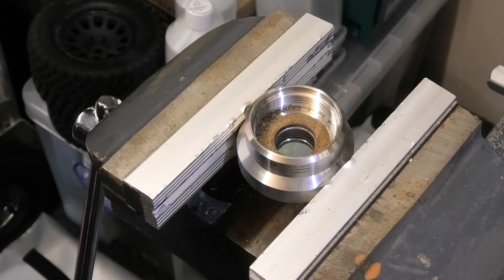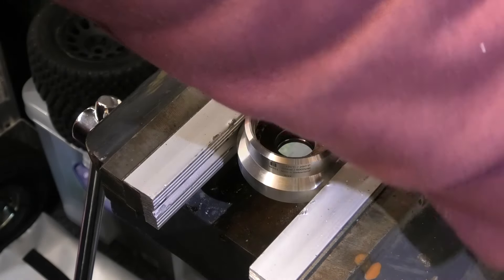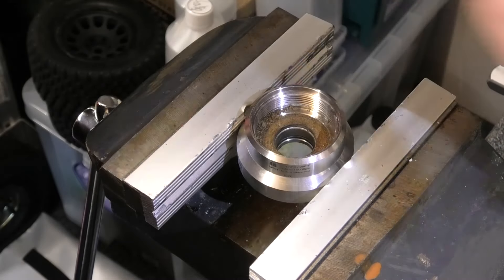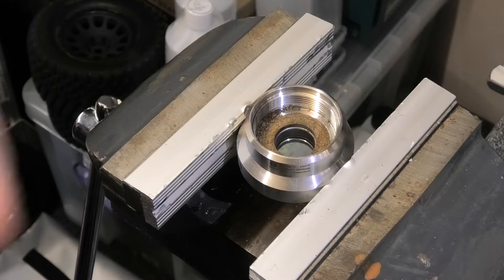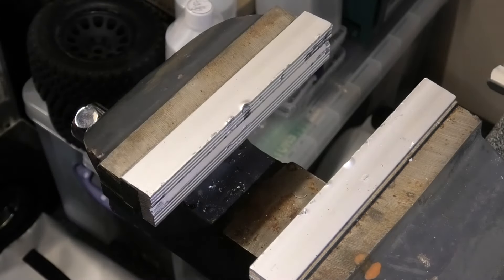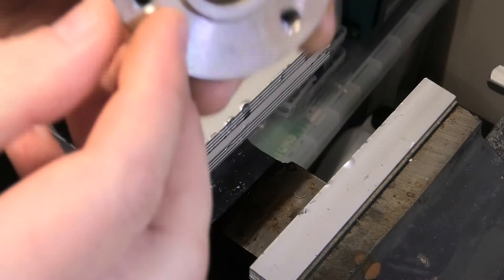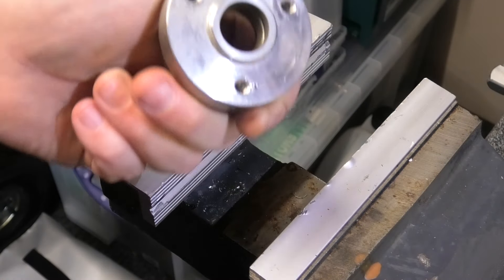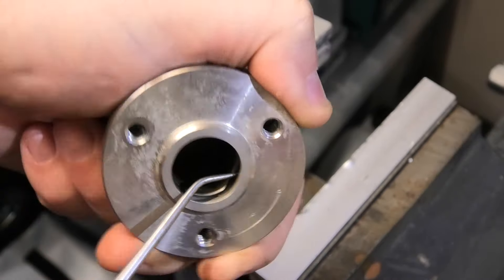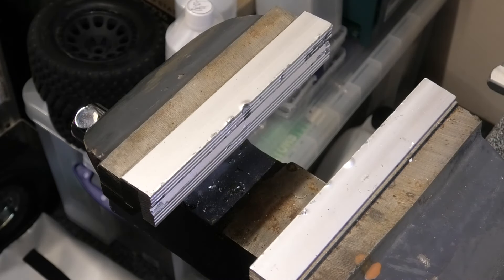That large one is a 40mm by 2mm o-ring, and the smaller internal o-ring is also a 2mm o-ring — they're all 2mm apart from the little one that seals the main arm. That small one sealing the spray arm is a 14mm by 1mm o-ring. I'll list all the o-rings later. Taking this out and getting rid of those rusty shavings — it was pretty badly corroded in there. There is another o-ring on the inside: if you pull out the inner bearing race it will just fall out like the top one did. Using your engineer's pick you can just pick that o-ring out — it's a 20mm by 2mm o-ring, and there are two of them in this unit, one under each of those bearings.